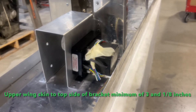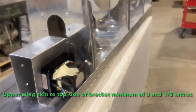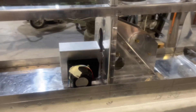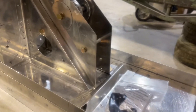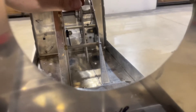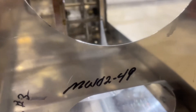The servo motor is in place. The next step is working on the arm. One thing about the Dynon is they sell a limiter bracket on the front of the servo that limits travel so you don't go over center. In talking with Rob, I don't need to use that bracket on this one because the bolts that go through here are actually the limiters - travel is limited against that stop one way and against that stop the other way, which prevents over-rotation and over-center condition of the servo motor arm.